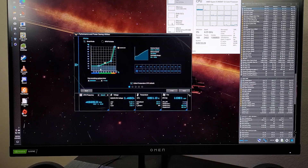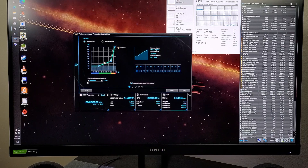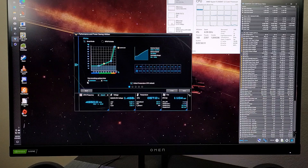Let's start with the CPU fan — this is what's plugged into the AIO. The three fans appear as just one fan curve. The way I devise this is by monitoring things in HWiNFO64, a free application — I'll put a link in the description. There are areas for CPU temperature, GPU temperature, and specific die areas like CCD1 and CCD2. One thing I like to do is use fan smoothing — it's a timer. Processors will have burst moments of short increased temperatures, and you don't need the fans to ramp up immediately in an AIO because there's liquid inside.